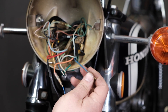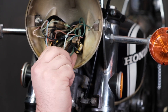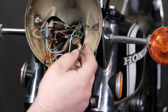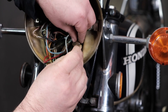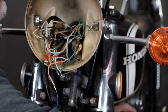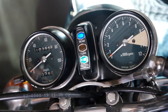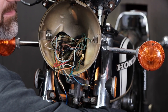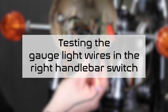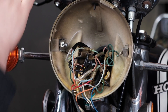The other little blue wire taps off to go up to the gauge bulb indicator. That circuit goes from the blue wire, through the bulb, back out with a dark green ground wire to ground. This bulb should be getting 12-volt positive. I have a solid black wire — 12-volt positive — here inside the headlight bucket, so I can touch it in here, turn on the key switch, and verify that the gauge indicator light is indeed working. That circuit is working fine — it's a very simple independent circuit. That was a quick way to test to make sure that bulb was getting power.